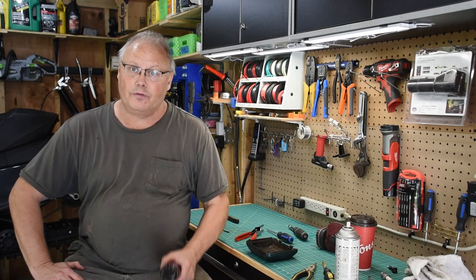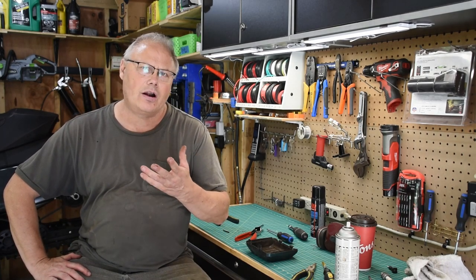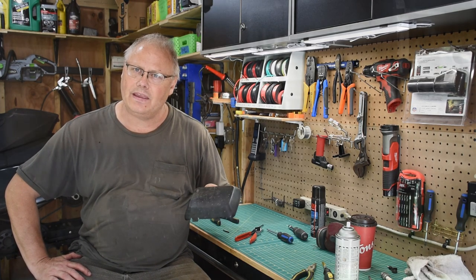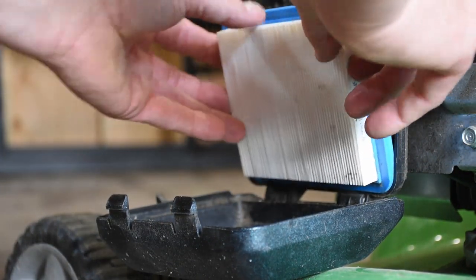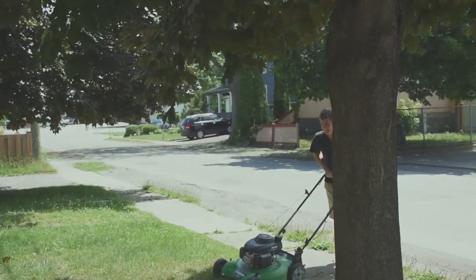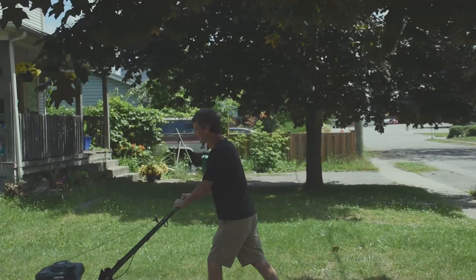Well, things worked out pretty well for Brian's lawnmower. I have it running, which is a good news story in and of itself — it wasn't running when he gave it to me. I've managed to clean the carburetor well enough that the surging is much much better. The only thing I have left is to go and get an air filter for him — I think that might even help with the surging a little bit more. Either way, he needs to have an air filter in that machine if he really wants to run it. For now, everybody out there — you enjoy this weather. Today is just absolutely spectacular here in Niagara Falls. I encourage you to come and visit us if you have a chance. Until next time, I'm Dino for Dino's Tinker Shed.